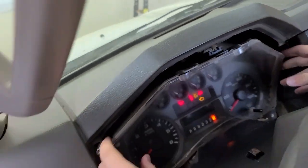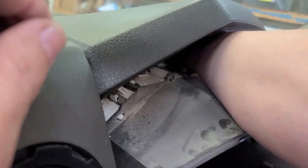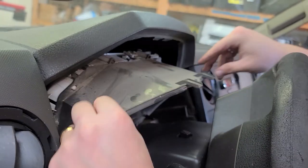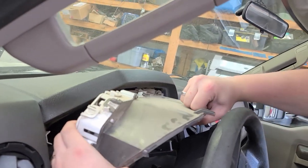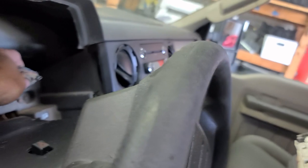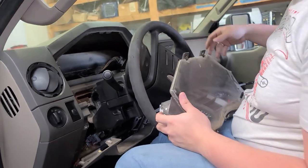Explain to the people what you're doing. Pull the cluster down - there's a little plug over here. The plug on the back side has a little pin that you push in, then you can pull it out and you're free. Here's why you want the steering column as low as possible - it doesn't give you much room for clearance. Pull it out to the side, be gentle with how you're moving it, watch your clearance. There's your little tab that you push to release the harness. There you have it - you're out.